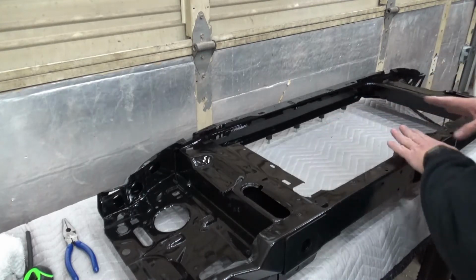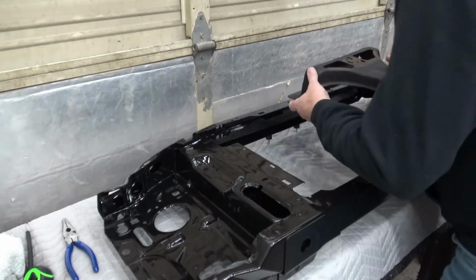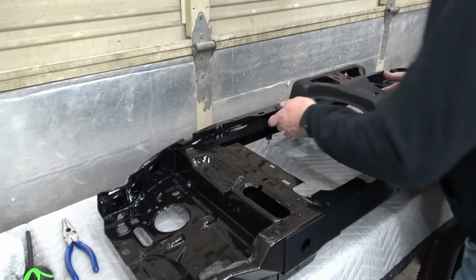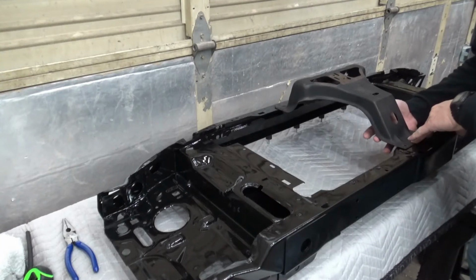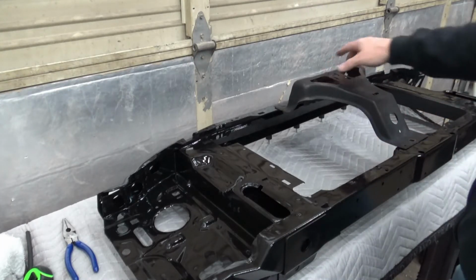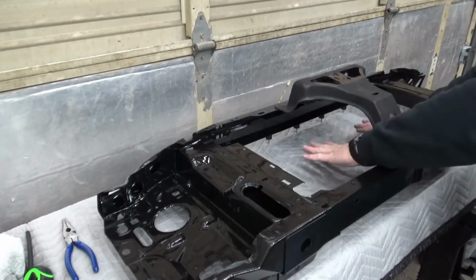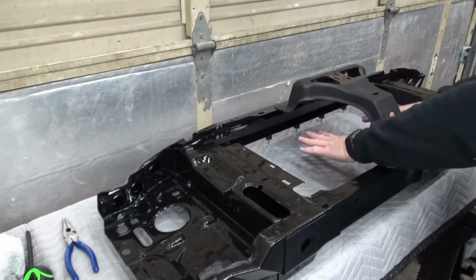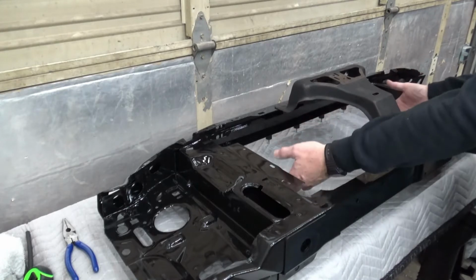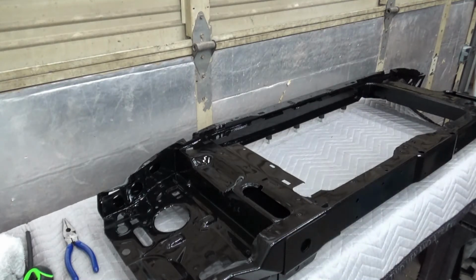And I know there's a hood release bracket that bolts on, so it mounts to the surface there, and it extends on into the condenser area a little bit here. I didn't want to have to modify that or buy one that has been redesigned in this area. You can get it, but it's quite expensive with their kit. Their condenser kit comes with the bracket, and it puts it out here a little bit to give you access for setting the radiator into the core support. I didn't really want to go that route, so I came up with this instead.